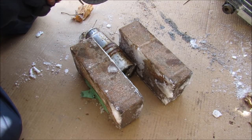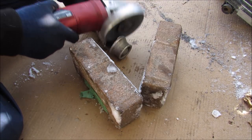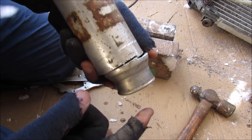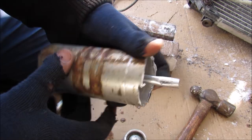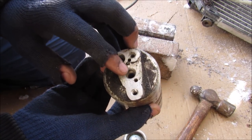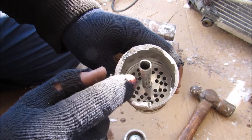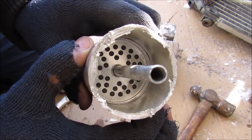Now I'm going to chop open the dryer to see what's inside. The AC dryer is actually a canister that's laminated on the bottom. If I remove this bottom piece you'll notice that there's this straw, and if you look closely that straw actually goes to the output port in the middle of the dryer. Over here we have the inlet port. On the inside there's this cheese grate kind of material and that's crimped onto the outside of this housing.